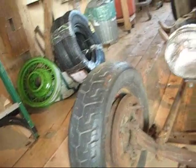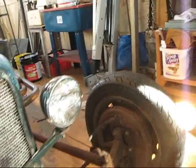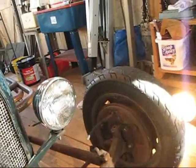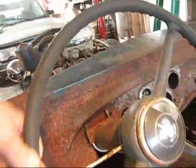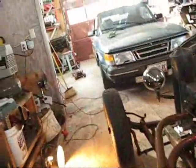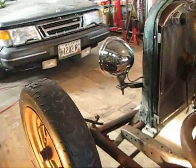However, they are shoe brakes. I learned how to drive on a car with shoe brakes and spent a good part of my life driving around on them. The thing about shoe brakes is it's awful hard to get them adjusted exactly right so they don't pull one way or the other. With this car having an old '57 Ford steering column, it's already got a boatload of play in it — that's all I need is for the brakes to be zigging and zagging me around every which way every time I try to stop.